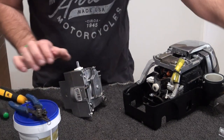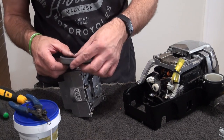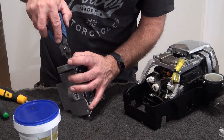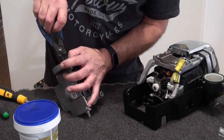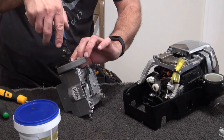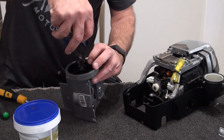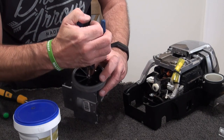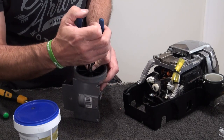Okay, and then your wheel literally pops back on, with the cutout shape there, and the opening for the circlip goes on the flat side of the spindle. So then we'll do that, and then we've got to get them out. And if you're like me, you've got big thumbs, these circlips are a pain in the ass. Right, it's in. Just got to get the circlip pliers out.